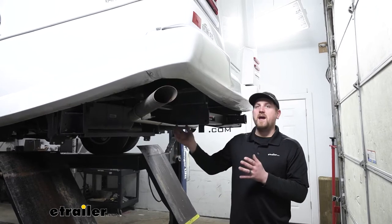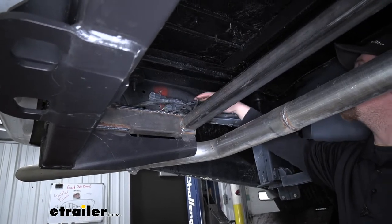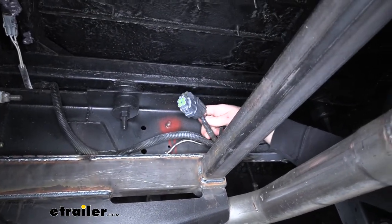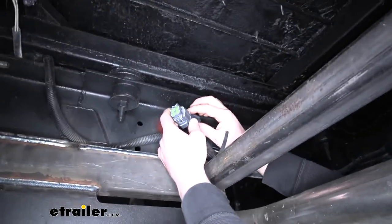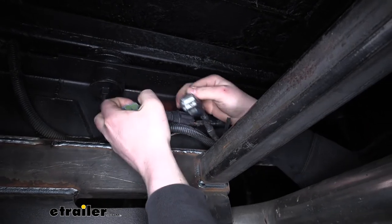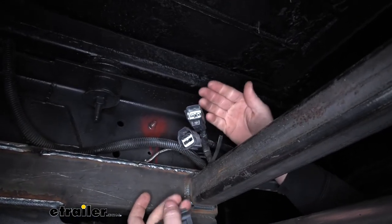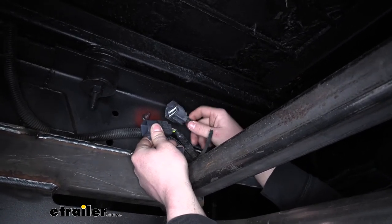To actually get our brake controller installed, we're first going to need to hook up our seven-way connector. We need to locate our factory harness, which is here at the back on the driver's side. If you look on the driver's side frame rail, we're going to have some wiring — the wiring that we need are these two capped ends. We can take these caps off; these are just dummy plugs so no water or anything gets into the connector itself. So we'll pull those off — push down on the center tab and just pull out. Do that for both of them. Now by just looking at it, we're not able to identify what wire does what, so what I'm going to do now is test each one of the wires to figure out what each wire does.